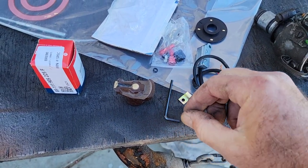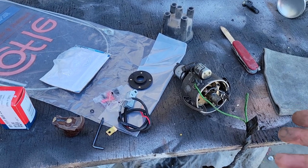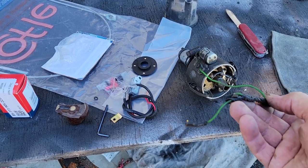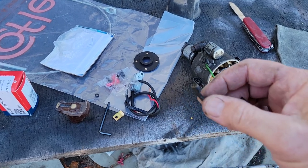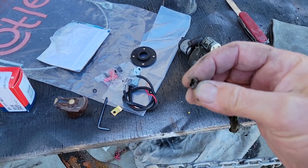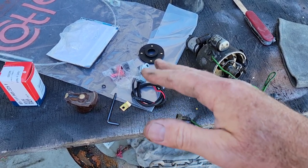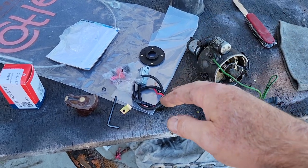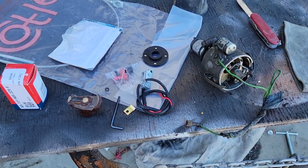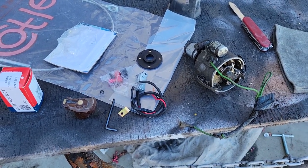They come with a nice little wrench to put it in. Personally, I have yet to have to change one that was bad. I did have one that gave me some problems, but I was also having a bad connection at my wire, so I think it was really that. In the camper van, I had a problem with the wire — this wire got a bad connection at the coil on my Ampy pointless. It was giving me problems before, and then I found out it was actually just the wire getting a bad connection at the coil. That may have been the issue. That's the only problem I've had with it personally.